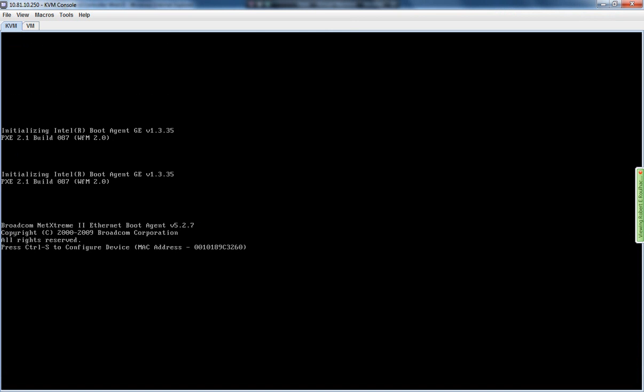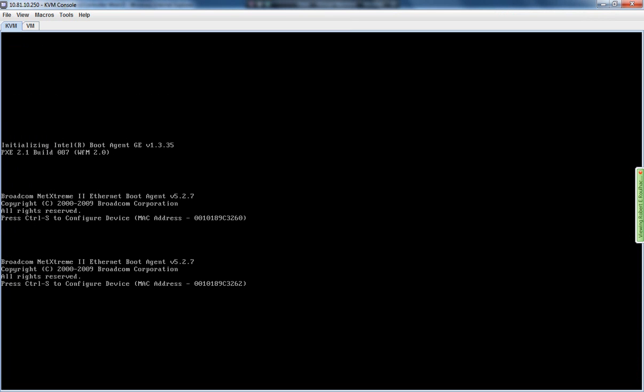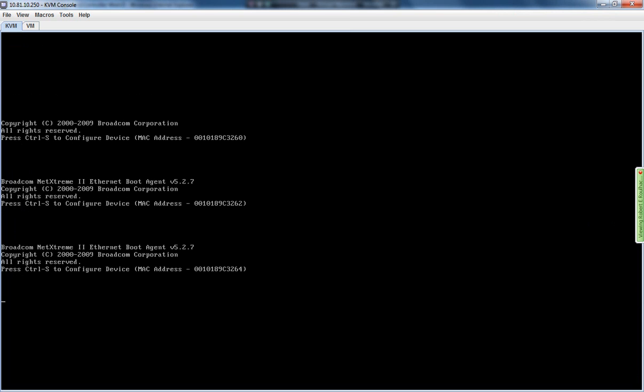Previously I've configured the host updates to update the firmware, and then I've updated the LSI MegaRAID controller to put the first two disks in a RAID 1 configuration where they're mirrored. The remaining disks are in a RAID 5 for the virtual machines.